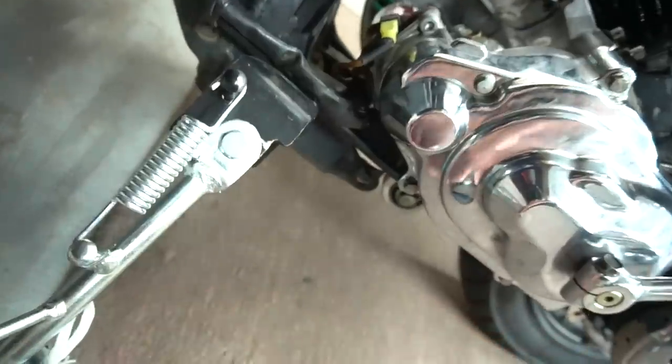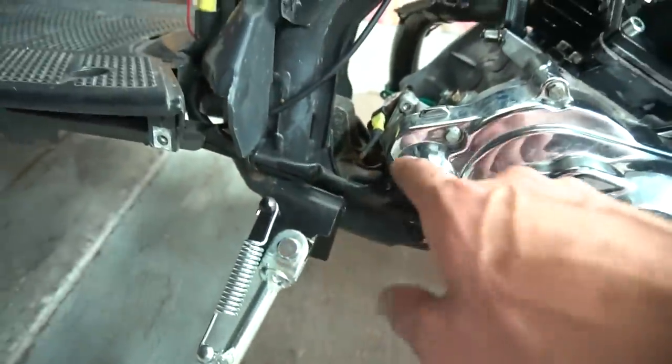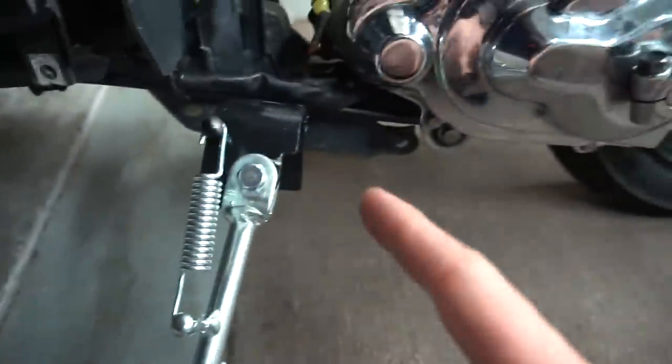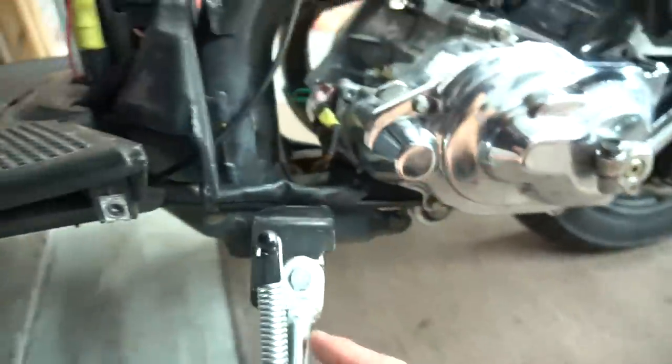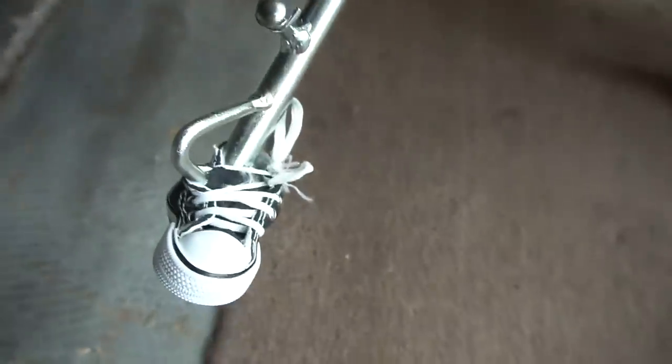This right here is the kickstand, which is a kickout stand instead of the center stand where it stands up on the bike, like I usually have on the Elite. Well, I put it here and was trying to move it forward as far as possible before hitting this seam because it was hitting the kicker case. I got to this point, but when I would kick it up, it would still hit the kicker case and it actually scratched the shit out of my kicker case already. So, what I did to resolve that, since I already drilled the holes and I was certain that's where I'm keeping it because there's nowhere else to go, is I put a shoe on it, baby.